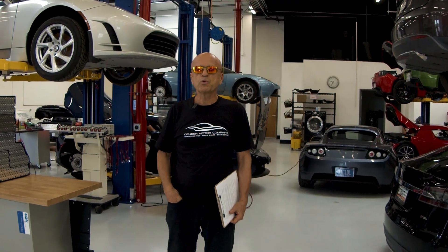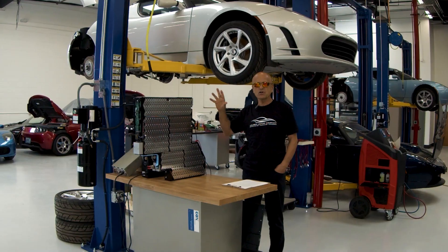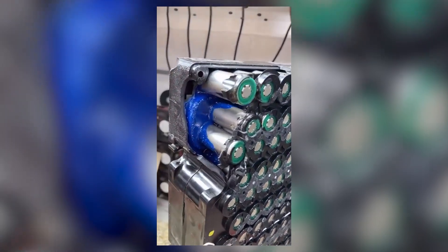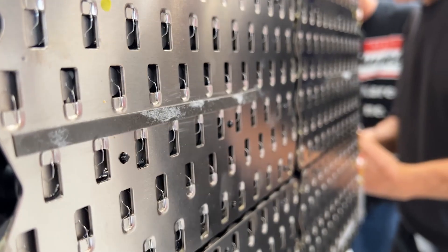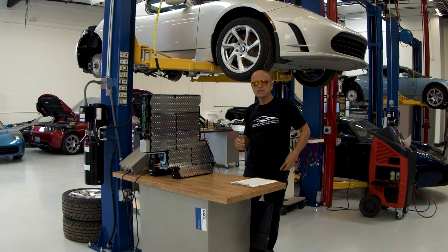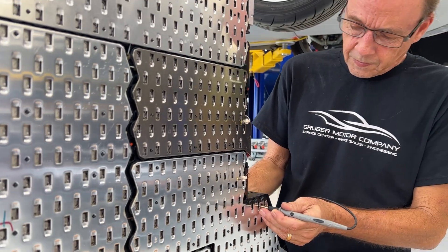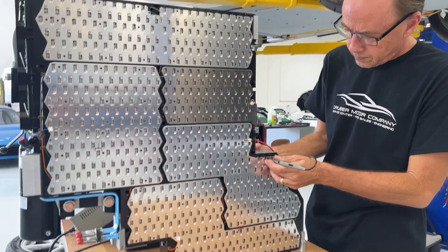Tesla's preference for encapsulating electronics and battery cells is not new. Starting with the Tesla Roadster, 6,831 cells are embedded in a thermal potting compound, which includes a cooling jacket under bonding plates with 138 wire bonded connections, rendering cell replacement into the realm of near impossible. But we found a way to isolate and remove resistive cells from this circuit, restoring functionality to Roadsters shipped to us from all over the United States every week.